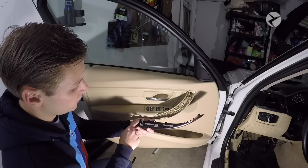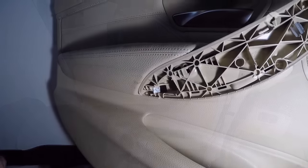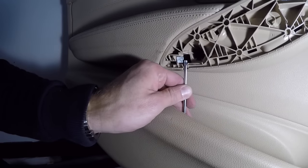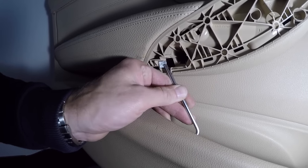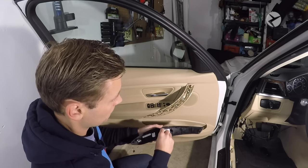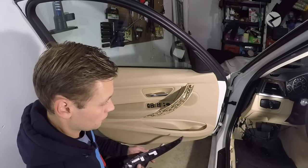Here's what the piece looks like — there's a larger clip on the bottom and a smaller clip on the top. When you go to replace it, put the top in first and then clip in the bottom. You can see right here is where the notch is. Slide up a small object — an Allen key or small screwdriver — and press this clip in to release the other clips on the wood trim. If any clips are stuck on the trim, just gently pull them off and clip them back on the door.